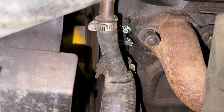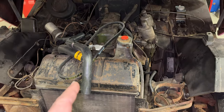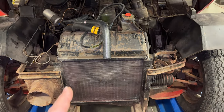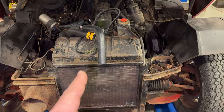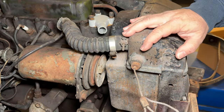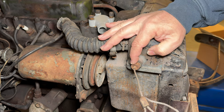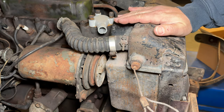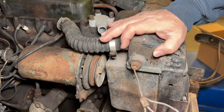I could probably change the water pump without removing the radiator, but because I also have all these other things to do, I think it's easier to just take the four bolts that hold the radiator in, disconnect the hoses, take that out, and then I can get to the water pump really easily. On an early Sprite, the hardest part about removing the radiator is getting this bung for the water temperature out. On later Sprites this is plugged into the head and not the radiator, so you don't have that problem. But this is very rusty — I'm going to put some penetrating fluid on this first and hopefully I don't break it.